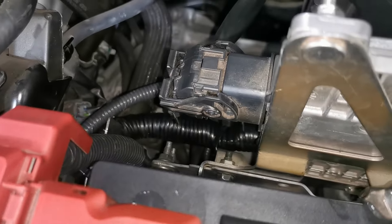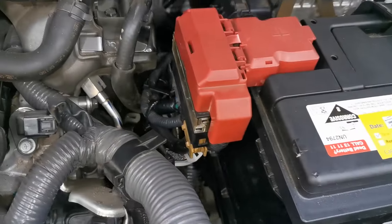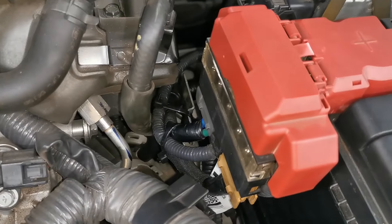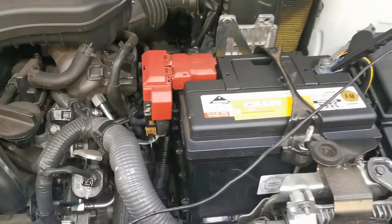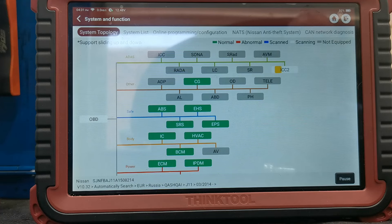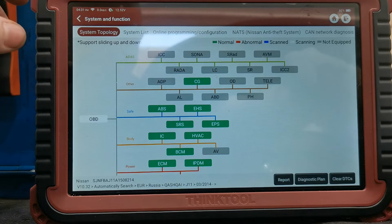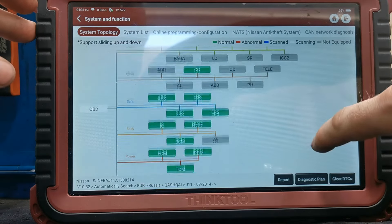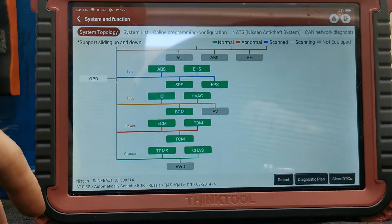The fault was within the connection, the wiring, and the extra stress and tension on that loom. I was able to clear all the fault codes and that signal returned. I monitored the signal in the workshop for well over an hour, did a screen recording, and confirmed there were no dropouts in the waveform at any time. I then brought it for a road test to see if any faults came back.